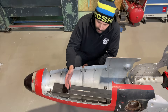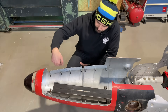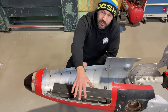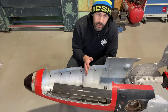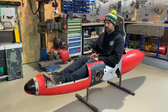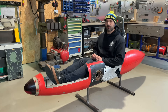I'm going to mark where my feet are, then cut and slice this out, brace it up, and build a nice plate. It'll eventually need some steel hoops in there for strength and to mount the steering rack, with front suspension coming out each side braced off somewhere — but that's a bit later. I want to get comfortable in the car first and build around me. Lots of people say why not just make the tank bigger, but that's all part of it — engineering something that sort of shouldn't work.